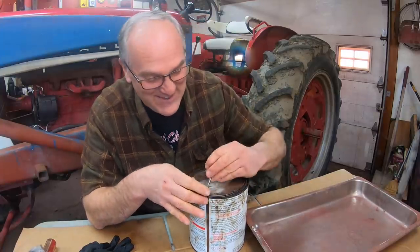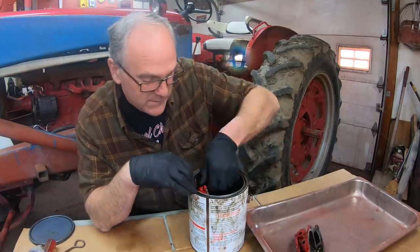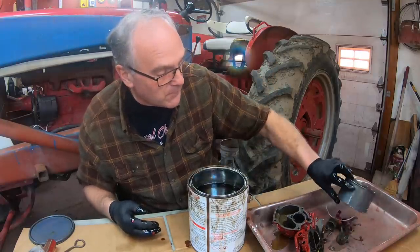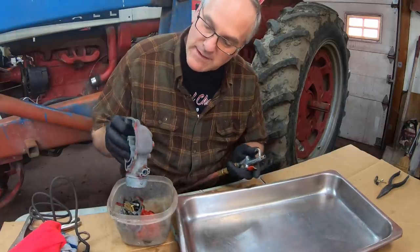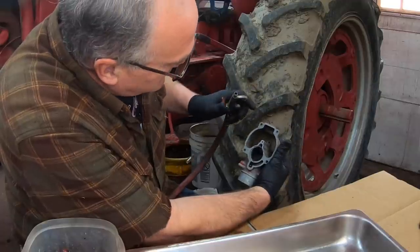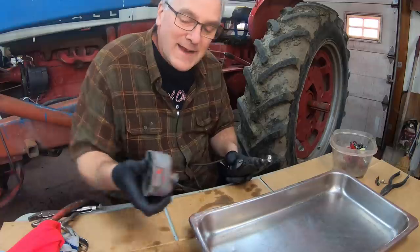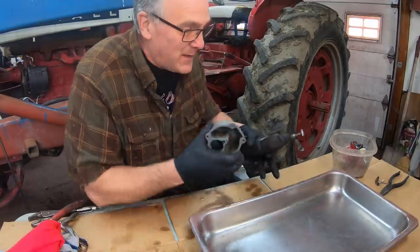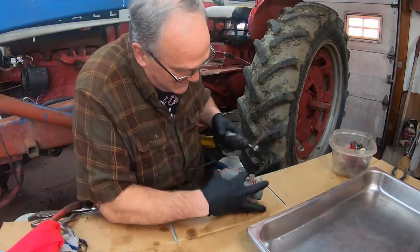Let's pull the parts out and see how they did in the soak overnight. It wrinkled up the paint good — hopefully that won't be too hard to take off. Dump all the little pieces out, and I'm going to take all these goodies out and wash them off with water. I washed them all off with water and did a little scrubbing to get most of the paint off. Now I'll dry them off with some compressed air — you want to make sure you get everything really dry and blow through all the orifices and holes in the carburetor. Then I use a Dremel with a wire wheel on it just to take off any remaining paint.